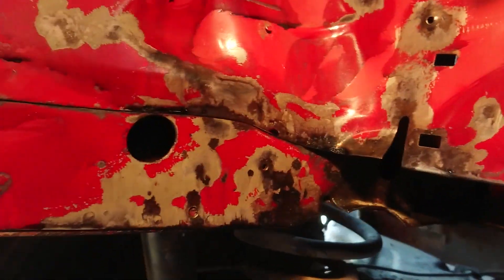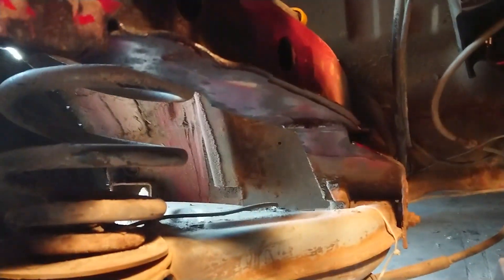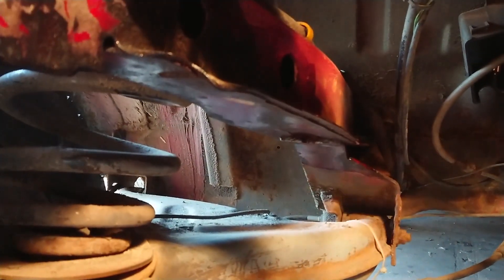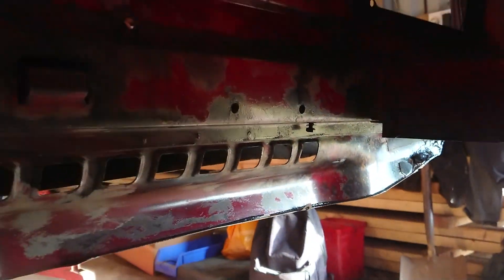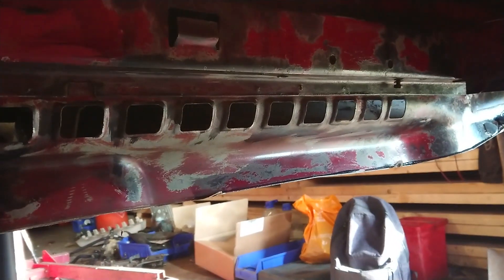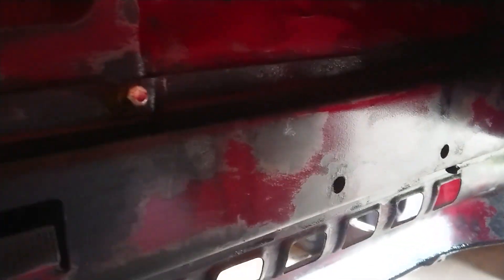What I've done is gone back down the chassis rails to where it joins onto the radius arms, and on both sides I've gone all the way down near that bracket, just taking the crust off and giving it a protective coat. The same on the rear skirt — all this was kind of crusty — so we've taken all the rust off that and also a bit under the rear corner as well. Hopefully it should be solid once we've given this a coat.